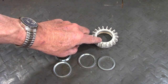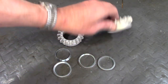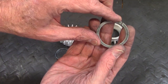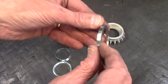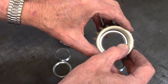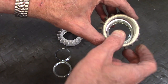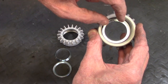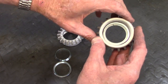This is the nut that screws into the spigot on the head and there are two sealing rings. One of those rings has a split in it and the other is solid, and both have a taper and a flat. The solid one fits inside, and then the one with the split — its taper mates up with the taper on the solid one. When you tighten the nut it squeezes the split ring tight around the exhaust pipe header.